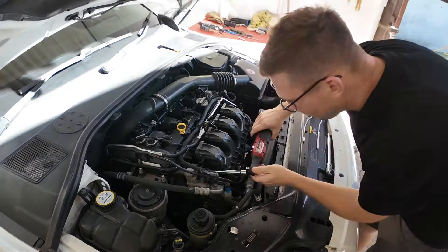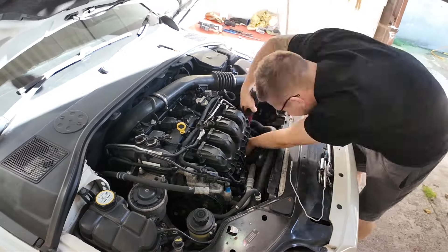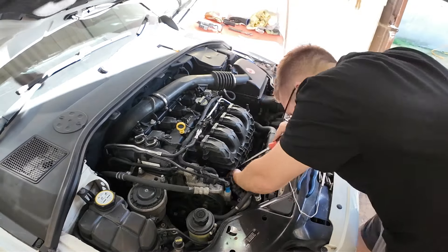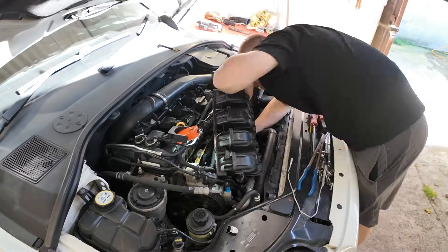In this episode we're going to change out a PCV valve — it is burning oil. I know it's had a complete lower block, brand new, and a reconditioned cylinder head, so I'm going to rule out piston rings and valve stem oil seals straight away.